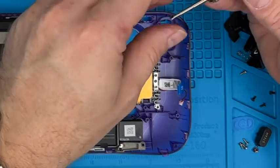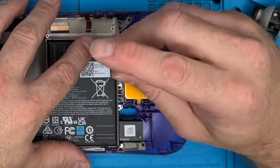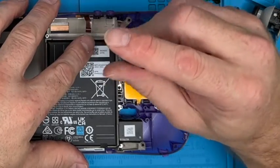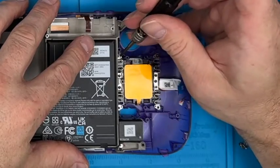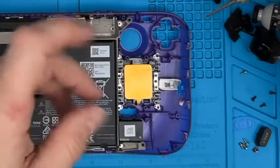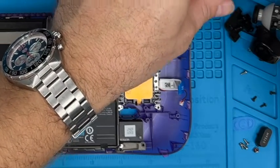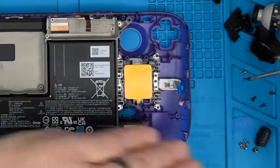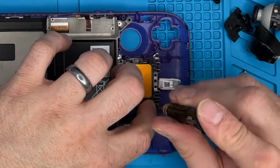They're a little bit tricky to put in, and you've got to give them a little bit more pressure, but again, not rounding the screws off and not damaging the thread. So it's a tricky balance, and it's a feeling thing. I think you get the feel of it. And also, it's easy to go, oh, that feels like it's tightened up, but it's not. As well with that screw, it still had a millimetre or so that it would float in it. So yeah, it's a feel thing.